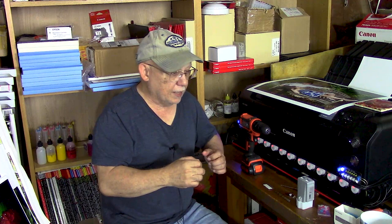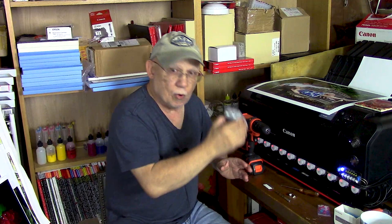And that is 80 milliliters of ink. So normally you will be warned around 20 ml left, maybe a little bit less, but safe enough for you to maybe continue printing one day. And then at your leisure, you can go ahead and top it off. So all we need to do is drill a hole.